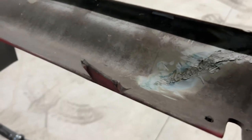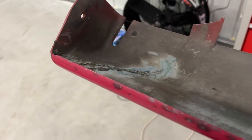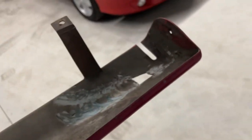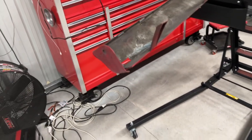Got our first plug weld - you can see through it, not too shabby. I haven't done too much plastic welding, only with a soldering iron - same concept but not too bad. We'll cover it up with some Bondo to smooth it out and make it look prettier. It's also reinforced and came out pretty good. Second one's not too bad either - we're going to need to put some filler between this one and then the rest of the crack there. That'll be covered up with just a tad of body filler. Since this part is actually underneath the car you won't ever really see it, and this will be the part that we panel bond. Everything else gets sanded down and should look pretty good.